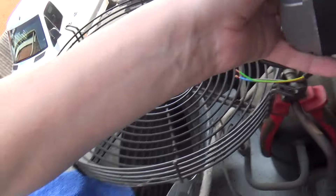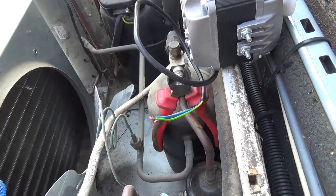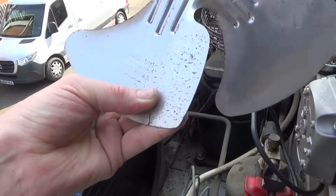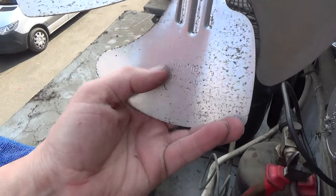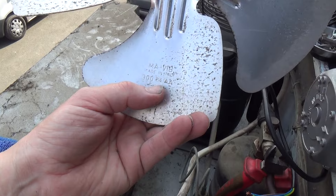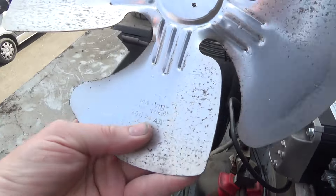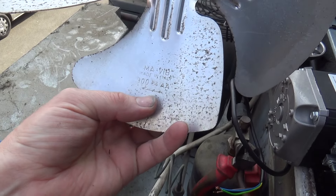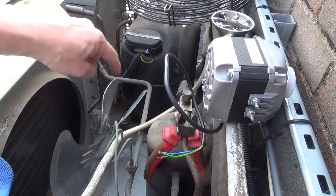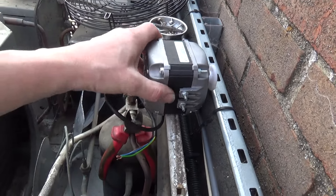The shaft protrusion's the same. Now the stack height - which is how thick this bit is - is the same. So I'm going to look it up on a chart and see if that is within the acceptable range of what this motor can do, because we've got a 300mm blade. I don't know if that's a 23 degree pitch - not very sharp pitch. If it's a shallow pitch you can even run that size blade with an 18 watt motor. But anyway, it's this or nothing - that's all we've got, and it's a weekend.